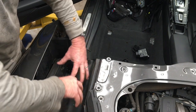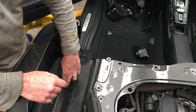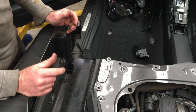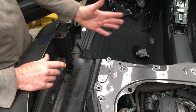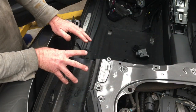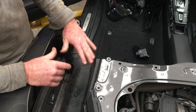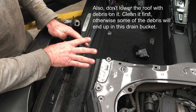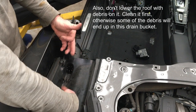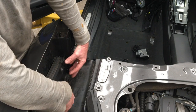The carpet overlaps all of this, so if there's any water or anything at all it ends up in this bucket. There are pins here designed to stop stuff getting down into the hole, but eventually stuff's going to get down there. To clear it out, you can remove the wind blockers at the back with the roof up and you'll be able to see inside - I get a vacuum cleaner in there pretty regularly. I'd also advocate occasionally putting the roof into service position so you can get underneath, use a vacuum cleaner and maybe some compressed air to get the stuff out, because the motor is sitting there and you won't be able to see any of it.